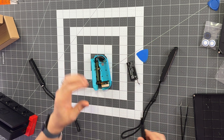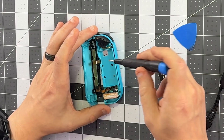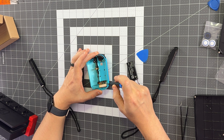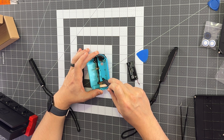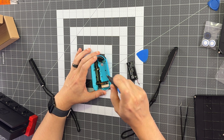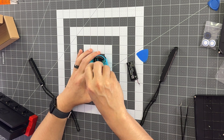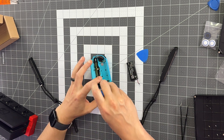This is where the process deviates from before. We're going to switch over to our Phillips screwdriver. There are more screws now—five screws to deal with. The top left, bottom right, and lowest right are the same size—a longer screw. The top right and bottom left are a shorter screw. So you want to keep these straight and in order. You don't want to put a long screw where a shallow screw needs to be. When I put them in my container, I put them in the exact configuration that they're going to go back in to help me keep this straight.